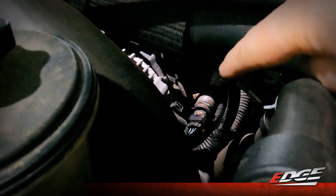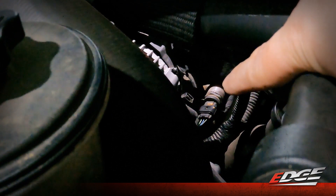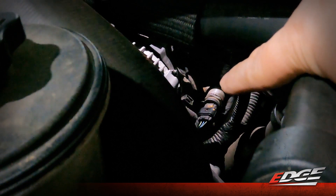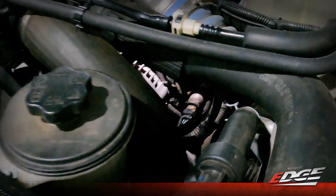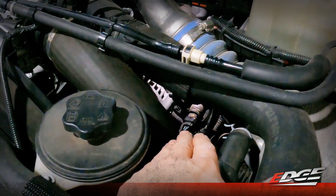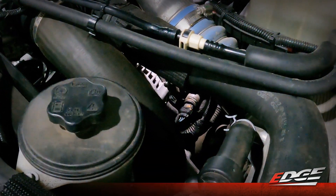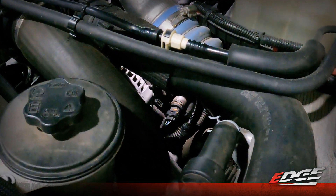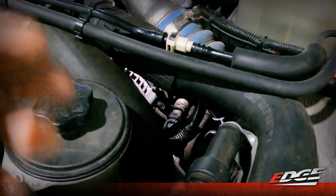Here it is zoomed in — that sensor right here is our fuel rail pressure sensor. We need to disconnect that connector; the detent tab to press is on the bottom side. You can get easy access to that sensor by reaching right between the power steering reservoir and under the coolant hoses. Then we'll plug in our fuel rail pressure pigtails directly in series, just like we did with our MAP and MAF sensors.